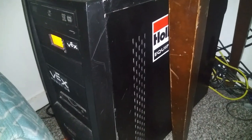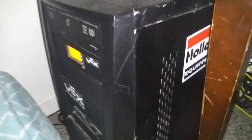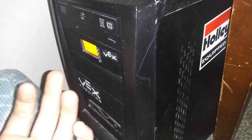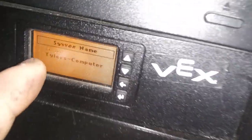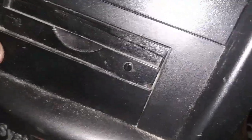I ended up going the expensive route and got the best board I could find for this application. The server version won't properly go on standby — it just flashes the light but still runs at full power consumption. I still have maximum fan RPMs because there's a missing front temperature sensor, which is why this little red light is blinking. I actually have a little digital screen on the front where you can shut the machine down and check thermals. And I have a zip drive — yes, it does work. I still use these. And a LightScribe DVD drive.